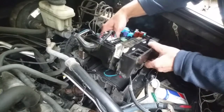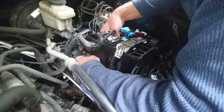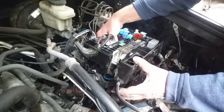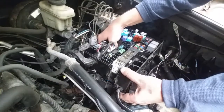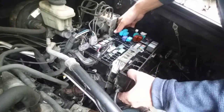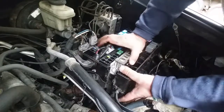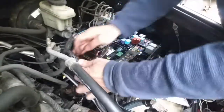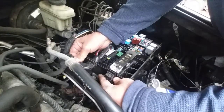We've got this case that we have to push down. Watch for this main battery cable right here. Line it up with all these clips — make sure you're not pinching any wires. You'll hear a bunch of clicks as it seats itself. That's going to get connected here, and to do that you have to slide it in the track, set it right down, hear another click, and that's in.